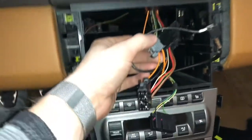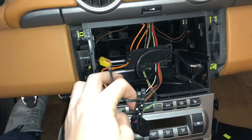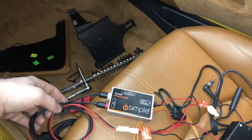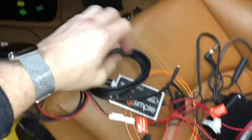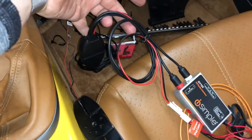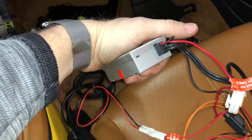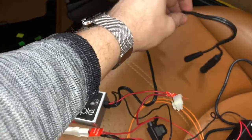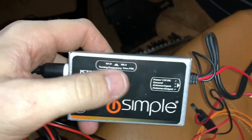This car has a fiber optic connection for the stereo amplifier, so your options for an aftermarket iPod input are very limited. I went with this iSimple unit instead of a knockoff because it comes with an interface adapter that takes a standard MFI-certified Lightning cable. The box charges your phone and breaks out the audio into RCA connections. After processing, it transmits out through the antenna on one of two frequencies — 87.9 or 88.3 — controlled by a small switch.